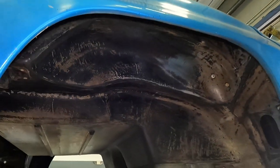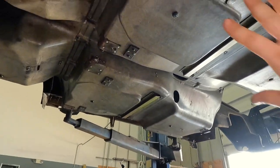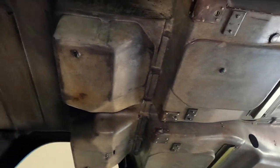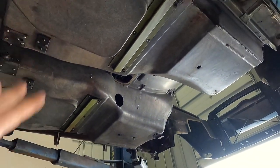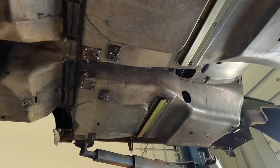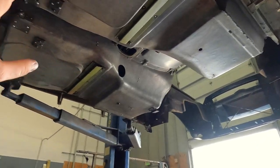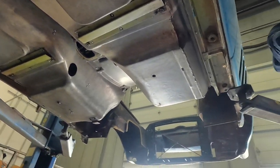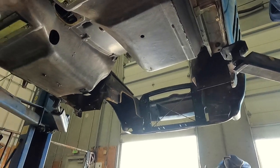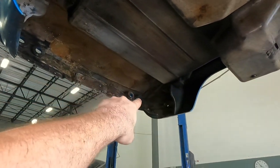And then this is the before, so it's a really significant difference. There are a lot of parts on these C2s where the bottoms will be left bare fiberglass. We still have a lot of lacquer thinner work and I'm going to try to get as much off as possible — get it down to bare glass and looking as beautiful as I can for this customer. This is probably representative of 25% done with the bottom of the car. We still have at least another three weeks of solid work underneath, in terms of sanding, painting, getting the fiberglass where it needs to be.